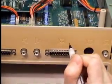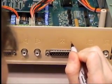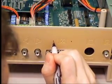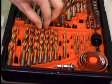The next step was to make the appropriate holes in the Amiga 1000's case. I decided to place them right above the main video connector. I also decided to bring out the Neobits composite video since I felt it was slightly better than the Amiga 1000's built-in composite video, so that meant making two holes.